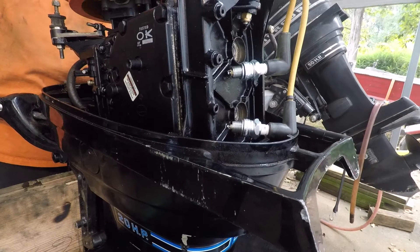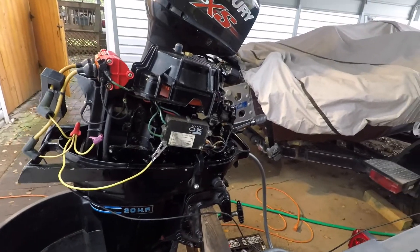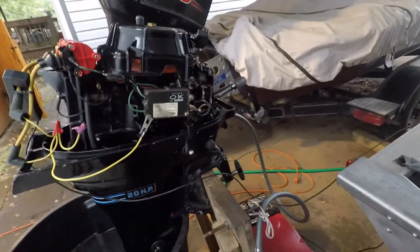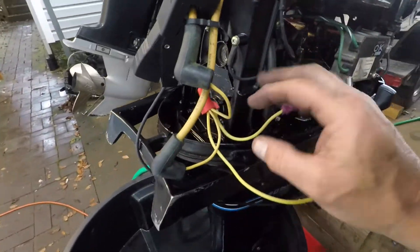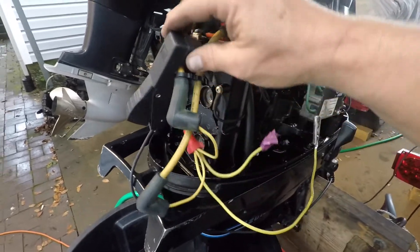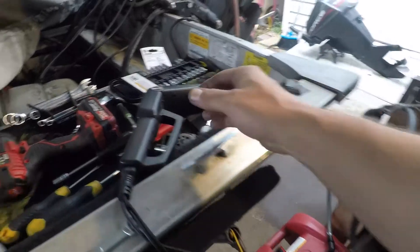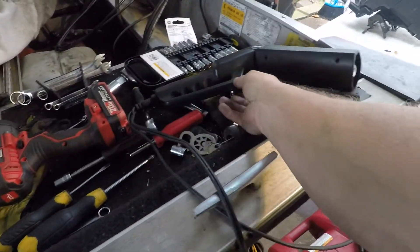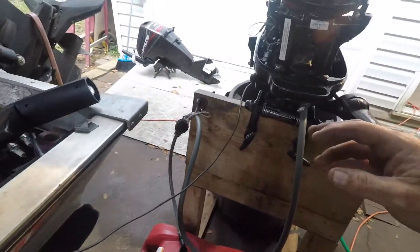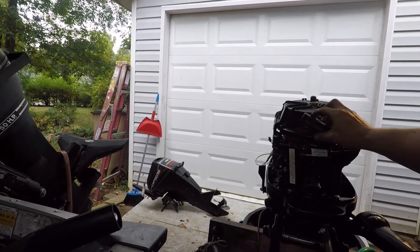Right about here I lost audio - you can't really see the spark. So this next video I've got my little thing that I made. It's just some wire going into a wing nut, and then I've got a gator clip to hook it to ground. I've got my timing light on the number one cylinder, and I'm showing where my battery is and my timing light.